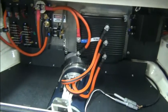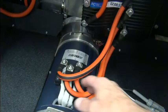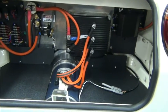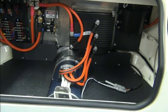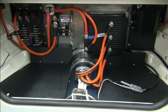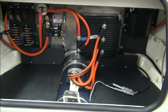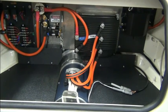So that was the high voltage stuff run. And of course our three phases, U, V, and W right here. Not a whole lot to it — it's pretty straightforward if you know the big picture, know what you're doing, know what size cabling you need, and properly crimp your lugs. This is not finished as I mentioned — we're going to be removing the motor.